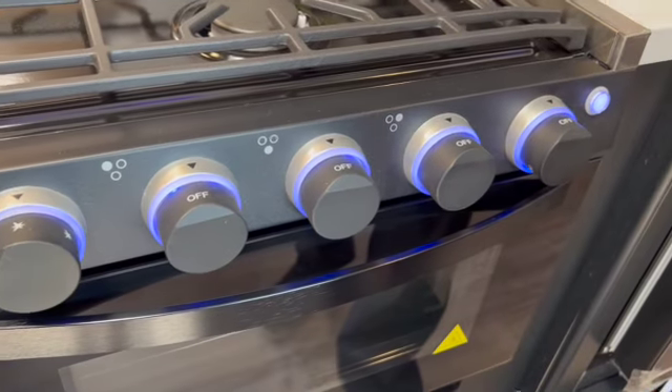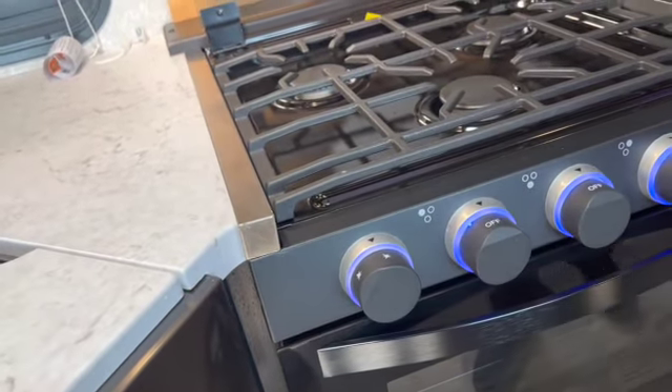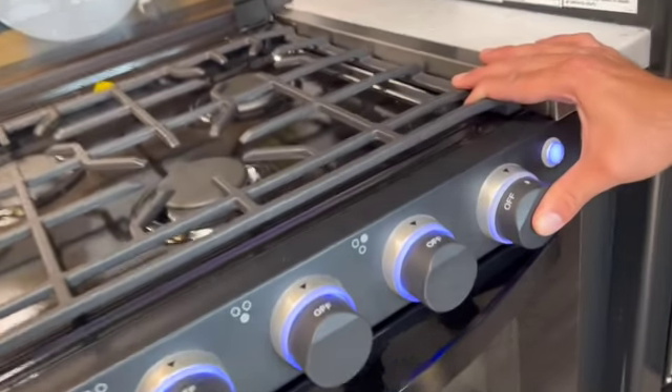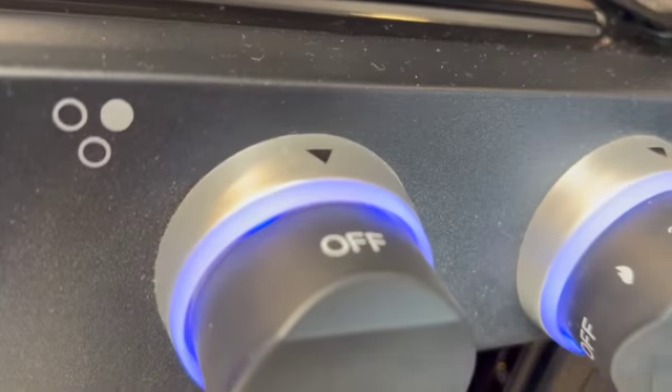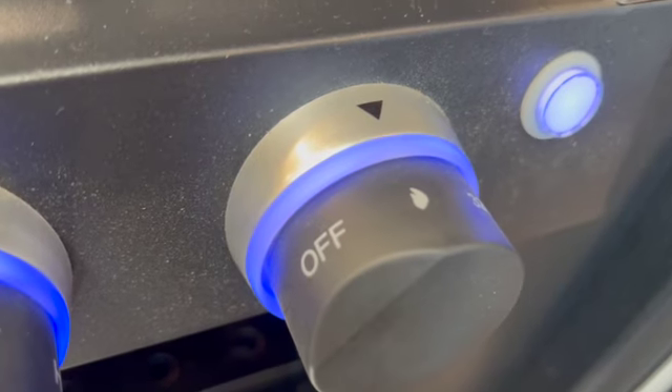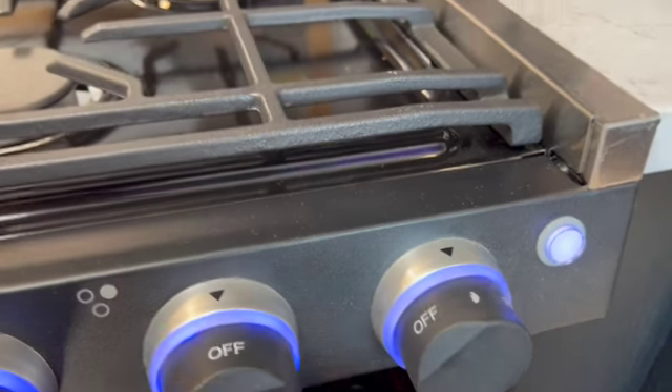The stove has three burners. For the oven, you do gas first, then igniter. Press the pilot light knob in for 15 to 20 seconds and then ignite. The key thing is this: there is a pilot light, so you hold that knob in, push it in, light it, and keep holding it in for 10 to 20 seconds before releasing. This is important — there's a probe under there that has to stay warm enough to signal the gas valve that it's safe to keep the gas flowing.